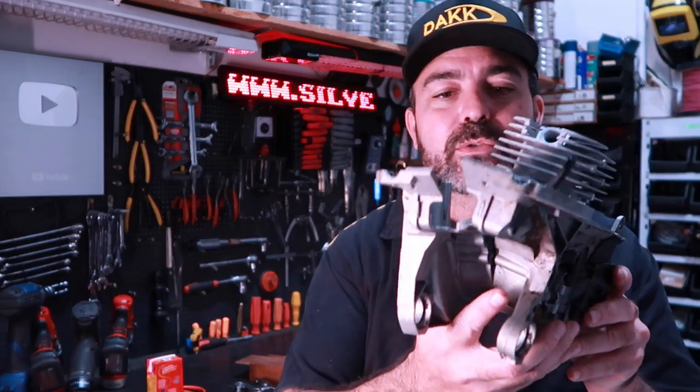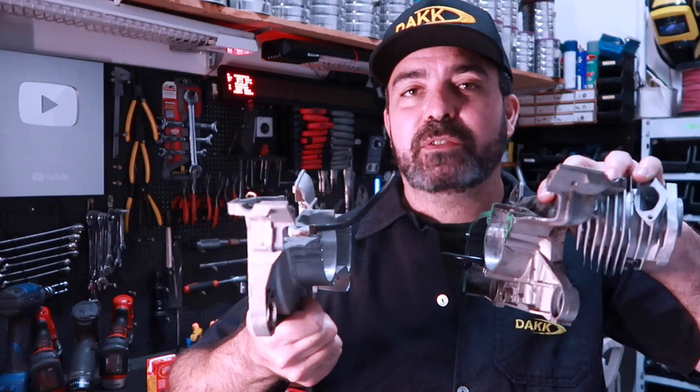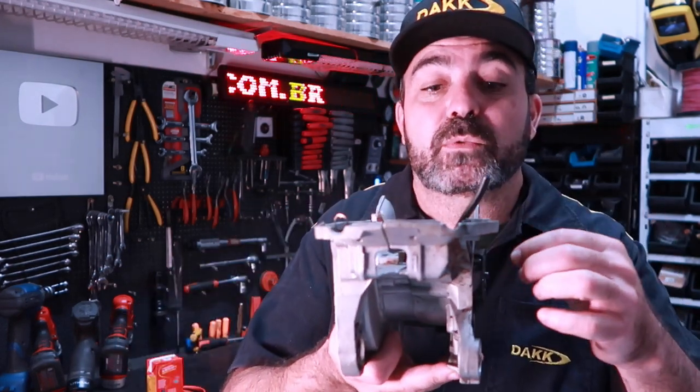Now let's talk about the material you'll use to make your gasket. Many gaskets — for example, here we have a chainsaw engine. On the chainsaw engine, the cylinder comes out and the two halves of the block separate. This gasket — for both brush cutters and chainsaws — it's important that its thickness, the thickness of this gasket, is correct. Because the crankshaft sits right in the middle, and the crankshaft spacing is calculated with the gasket in place. If you put in a gasket that's too thick — like Tetra Pak — the crankshaft will wobble back and forth, which will damage your machine and can eventually cause engine failure.